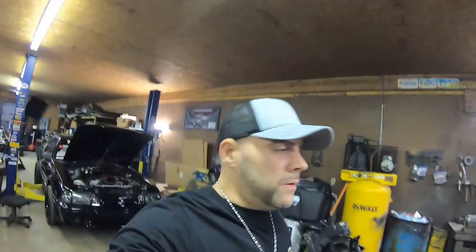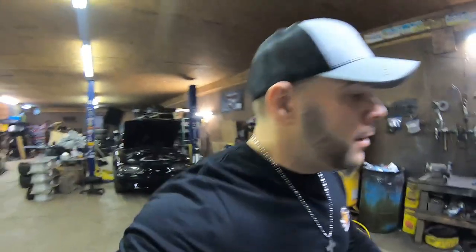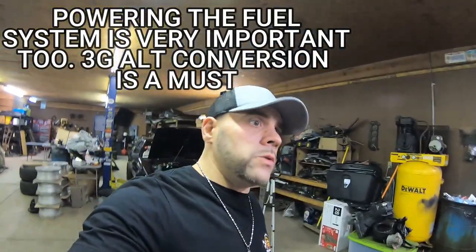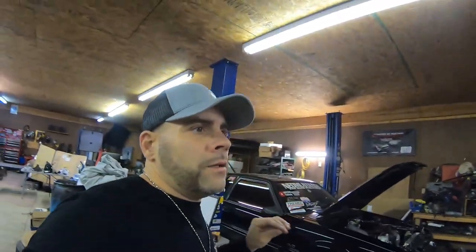That's pretty much it for a fuel system, but all that stuff is expensive, because I run E85, and in order to run E85, you have to run PTFE, which is a special coating, so the E85 doesn't eat up your lines. Now, am I saying that you should run out and buy MagnaFuel and PTFE, you know, Bosch 160-pound injectors or IDs or whatever? No, you should not need to do that.